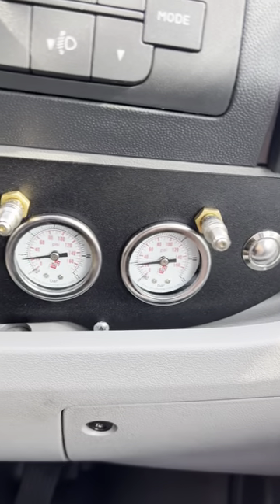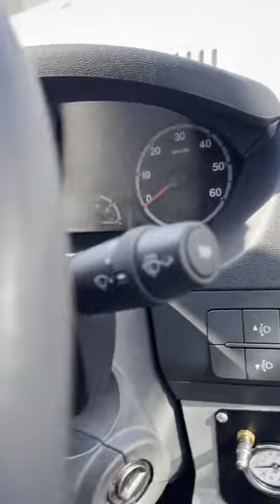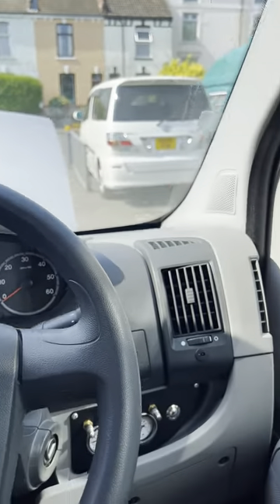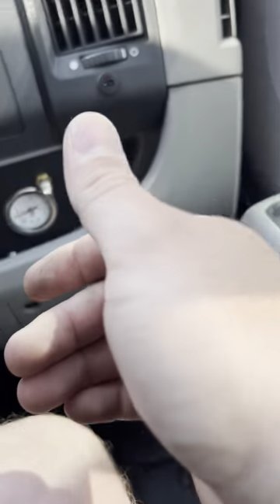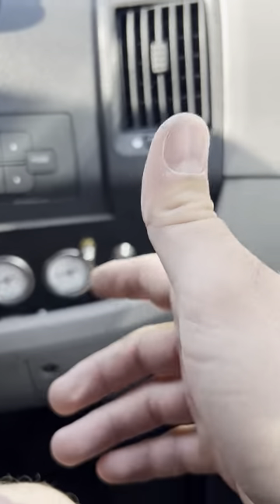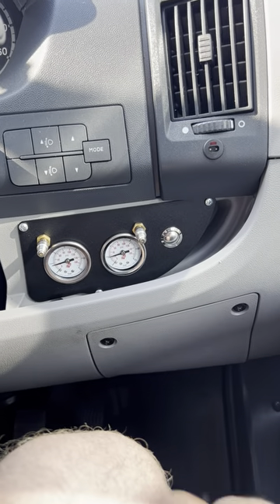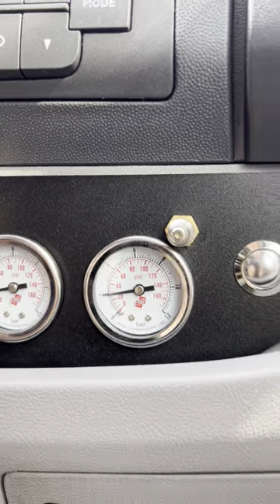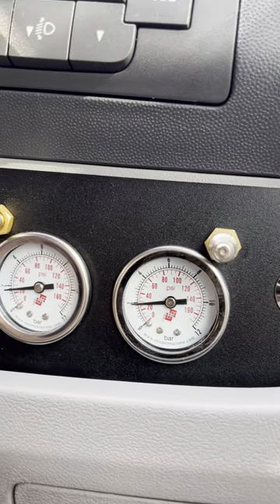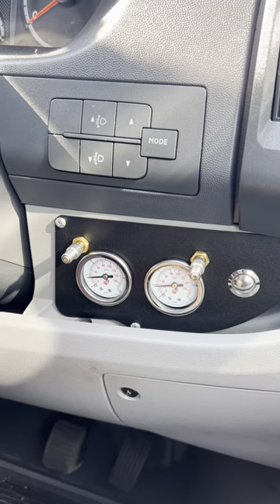You've got the air suspension — though it's not full air suspension like a truck would have. This vehicle still has coil springs and shocks, but the reason they have these — normally just at the back — is because when this van was built it wouldn't have been half as heavy as it is now. They're essentially like air bag assisters. All you need to do is keep your eye on them and make sure they stay at around two bar. If they start to drop you can just fill them up like a normal bicycle pump. It basically makes it a lot more stable and sturdy at the rear.